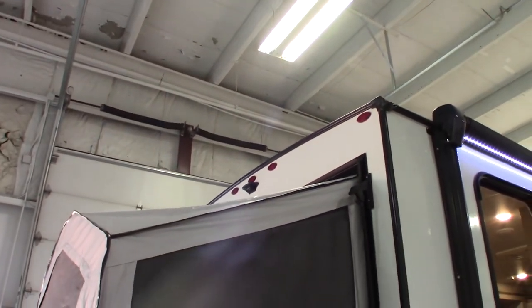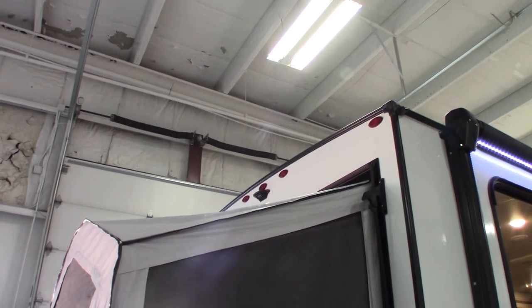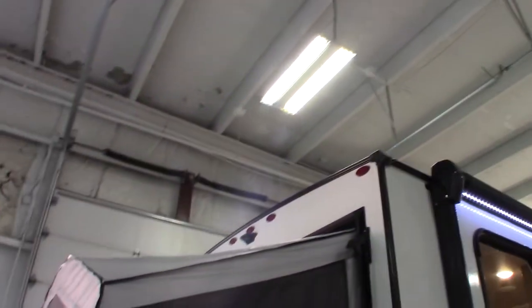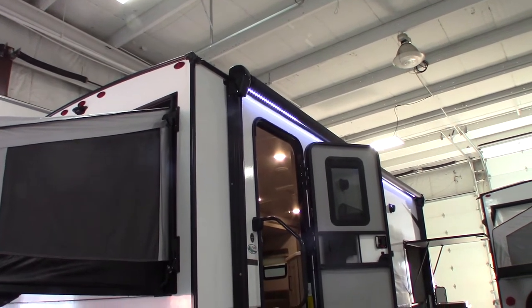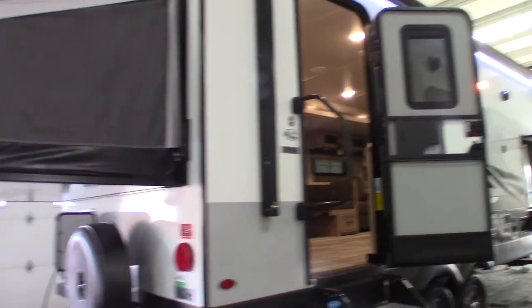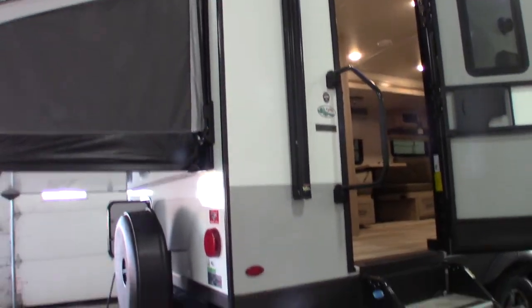This is just a dump hose adapter. On top of the trailer there's a housing for a backup camera — it's already wired for it. You just install the camera there, put the screen in your tow vehicle and plug it into your cigarette lighter, and you're all set. Also, the manufacturer states that every 90 days you should inspect the roof. Someone needs to go up there and look at all the sealant — make sure there's no cracking or separation, no damage from low branches or road debris. If you catch issues early and take care of them immediately, your trailer will stay bone dry inside.